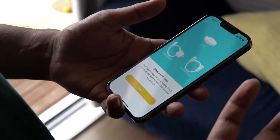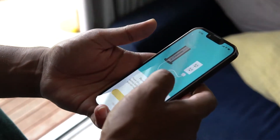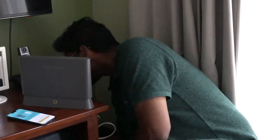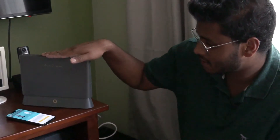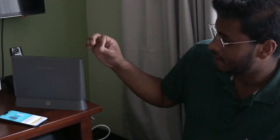The app tells you exactly what you need: one of your Deco access points, a power adapter, and an Ethernet cable — all included in the box. Then the first step is to power off your modem. Mine's located at the back here and I'll switch it off. There we go — the modem is turned off. You can see this is our default router from our internet provider; this is the Vodafone router and we're going to be swapping this out with our new M5.